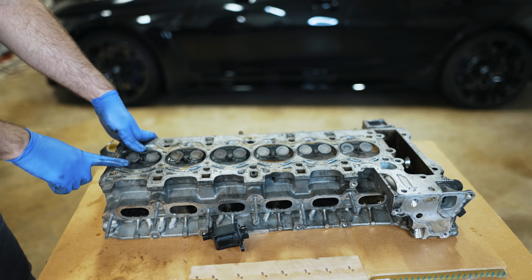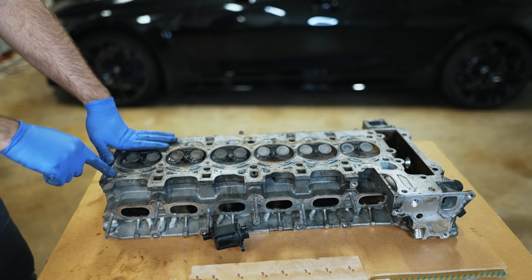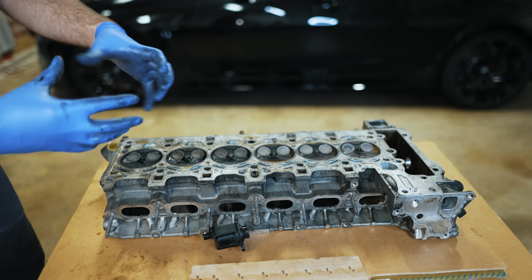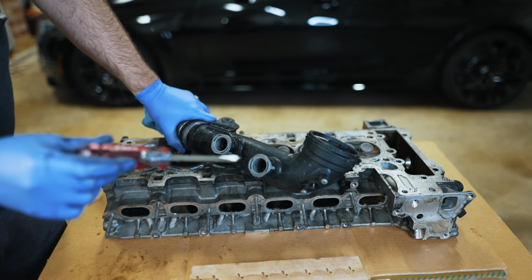It disables the spark in between gear shifts so that it can take whatever air and fuel was here and just send it out the exhaust, with the understanding that the exhaust will be hot enough, and the cat is right by the front of the engine, so it can deal with it and give you that nice pop sound when you're changing gears.